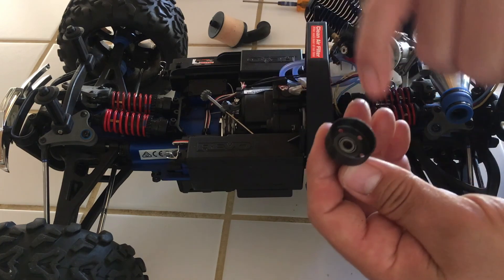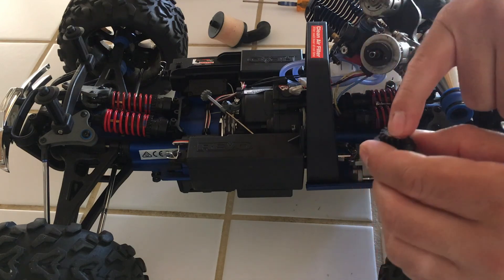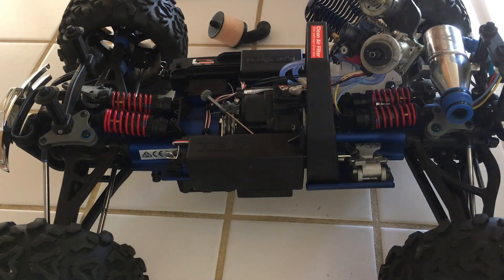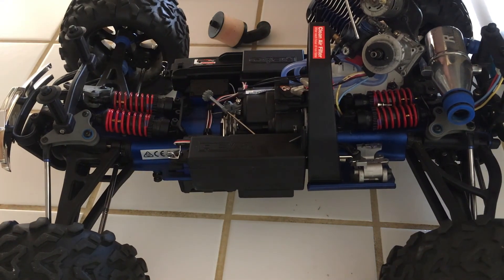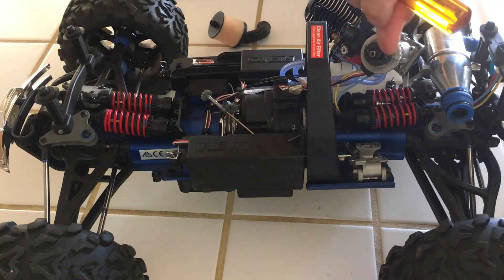And these are the bearings — the bearings are good. The inner one and the outer one. I'm just going to put them on the new bell and swap them. There's the clutch — this would be a very good time to replace the clutch. Look here at the clutch for wear marks, because there's a spring that holds both of those there, and that will wear out. It will wear out the spring, then break.